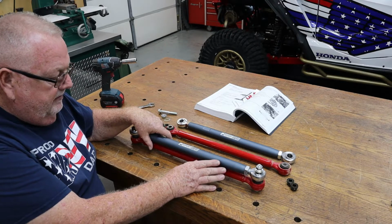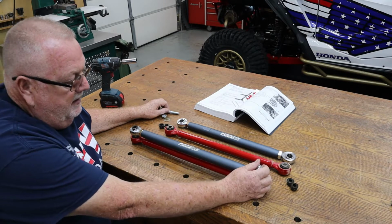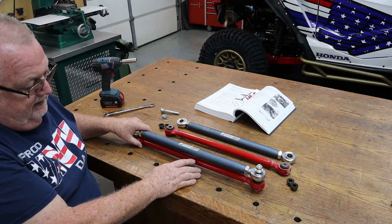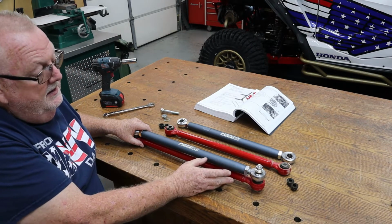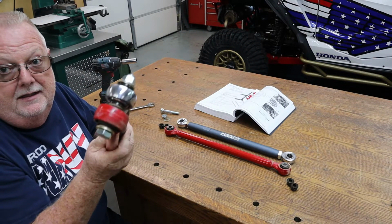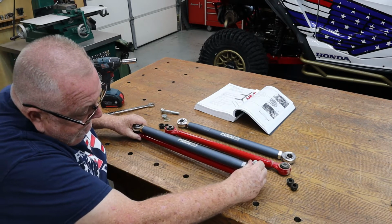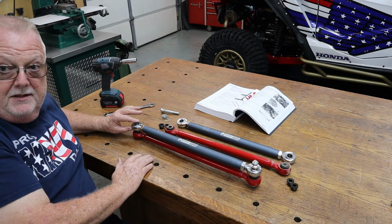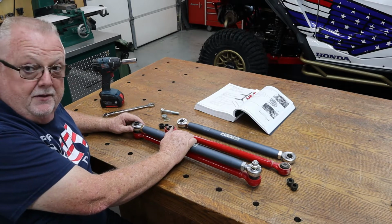if you just take your stock radius arm or radius rod, and the small end is 12 millimeter, the big end is 15 millimeter. I didn't have a 15 millimeter bolt. I did have a 12 millimeter bolt, so I used that, and I literally just bolted them together, snug this bolt up, and there's movement here, so you have to be a little bit careful, but I just lay it down, make sure that I've got that bolt perfectly vertical. I've got my bushings in here so I can line these holes up. And then it's just really just a matter of turning this rod.